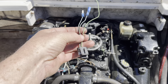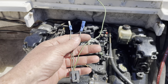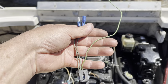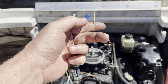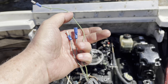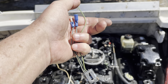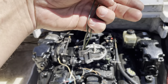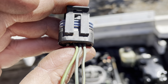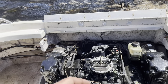To work out the shift kill harness, I've taken a four-way Metropack connector — actually off an old fuel injection idle control motor, which uses the same connector. I'm putting male and female butt splices on two wires, and this longer wire is your bypass wire. The way it works: when the two short wires are left disconnected and you put 12 volts on this longer bypass wire, you'll kill the engine. If the two short wires are connected and you put 12 volts on the bypass wire, you'll be in set timing mode. So this connector serves as both a shift kill harness and a set timing harness. The wires are labeled — C and D are the two you tie together, B is the bypass, and A is not used.